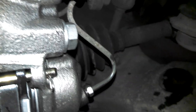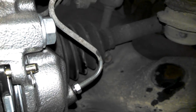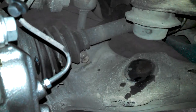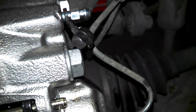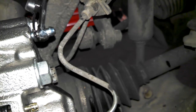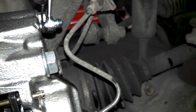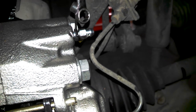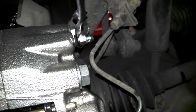I've gotten inside the vehicle and stepped on the brakes a few times myself - it does build up a little pressure, and we can open up the bleeder again here and get things going pretty good. I'll do this a couple of times before I have someone come over - it just makes things quicker. I like to use the foot pressure as a final bleeding step. If you were to close this, step on the brakes a few times yourself, then open this, step on the brakes a few times, open this again.